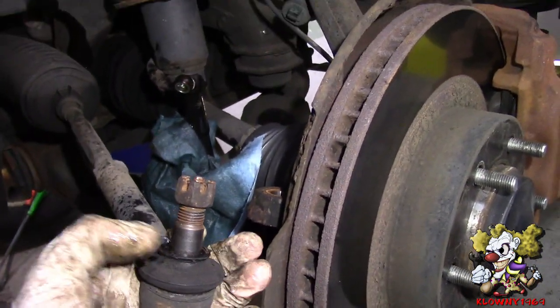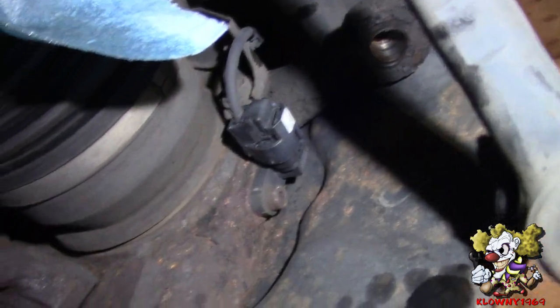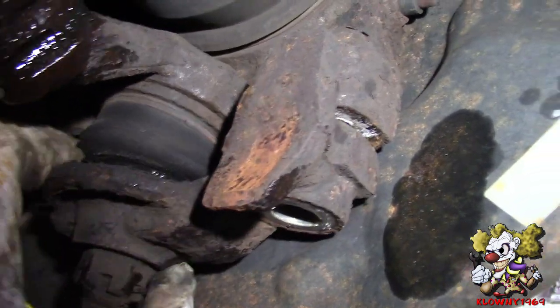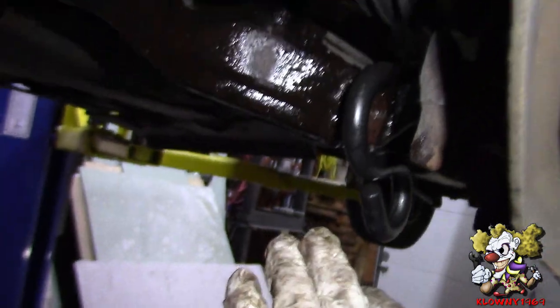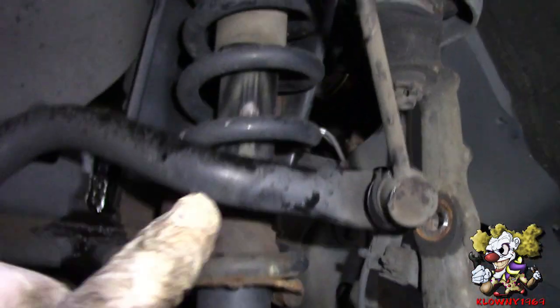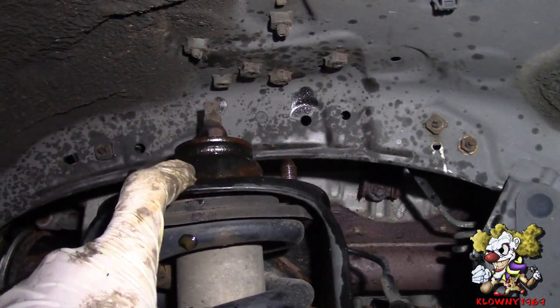Next thing is pop this tie rod off and put it to the side. There are two bolts here holding the lower control arm ball joint to the hub — these two. Now this is separate from this. What I do is put a little OTC tool here — I'll also put a link in the description below — I put this over here, put a pry bar and go down. You can go down a couple to three to five inches and it will give you some space to wiggle the strut out. So right now I'm going to show you what I do here to make this a snappy job.